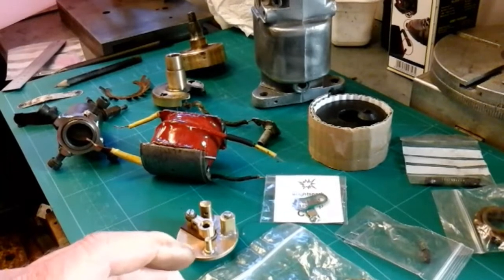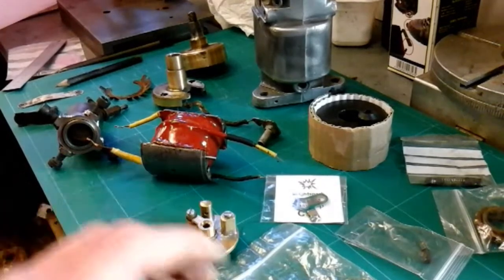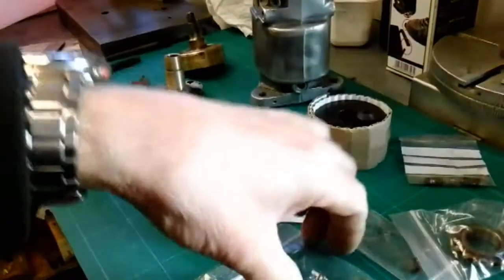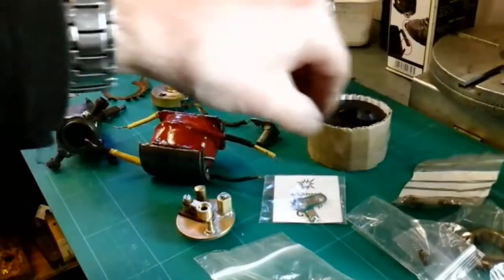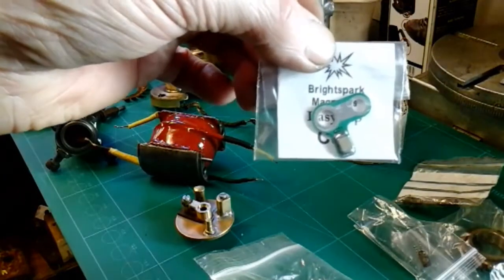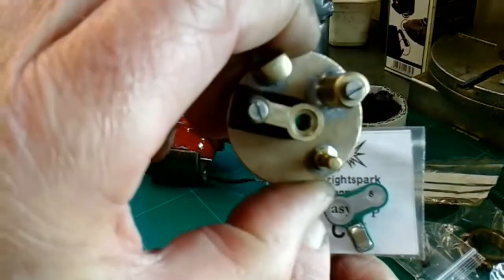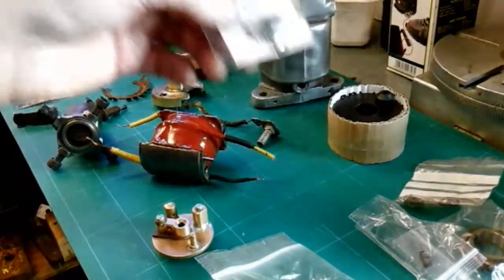Where I'm up to now on part three, I said last time I was waiting for my parts which I'd ordered. They've now arrived and I've got new bearings for both ends, earth brush, slip ring bushes, a new slip ring, and a bright spark easy cap condenser which I've never used before. Now this condenser fits on the front of your points, so I won't be using the existing condenser — it's no good anyway.